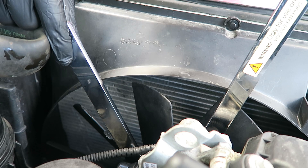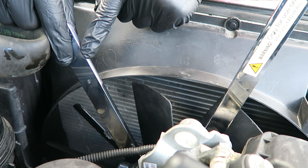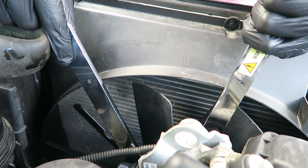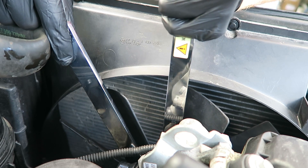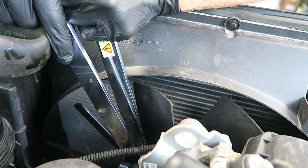Just as a reminder, we're going to be turning this clockwise to loosen and counterclockwise to tighten — it's the opposite of a traditional threading system. As you can see, with this tool right here I'm holding the water pump nuts, and this is our 32mm wrench in this hand. I'm going to be turning this wrench clockwise towards the driver side of the car.